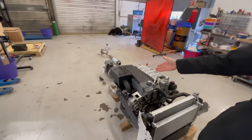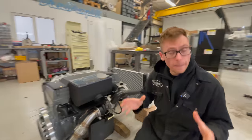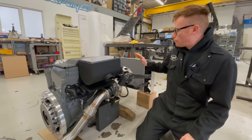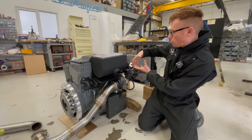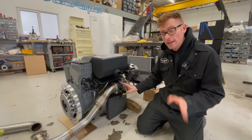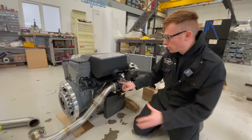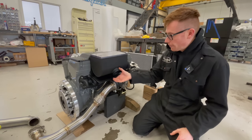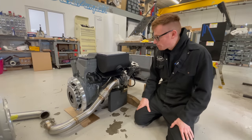With it being a Land Rover, it's also got the Land Rover airbox. Lots of customers ask me about bigger turbo setups and wanting to put all sorts of power into their Land Rovers. I have to often rein them back and say, if it's a right-hand drive, you're going to need a high-mount alternator bracket, which limits your ability to fit a giant turbo — because the turbo would be mounted too far forward and you wouldn't have room for the air pipe. So what we always recommend is the hybrid setup, which is good for 300 horsepower — amazing in a Land Rover — spools up real low down in the rev range and goes all the way through. This hybrid has been designed to work with our Land Rover airbox and the alternator bracket, so those three things together give you a nice compact solution, with a three-inch flexible hose straight to an air intake in the wing or a snorkel if you want to run one.